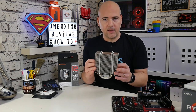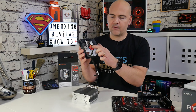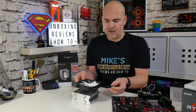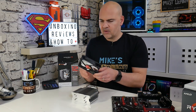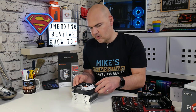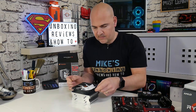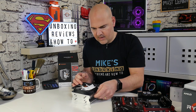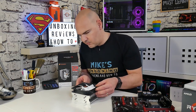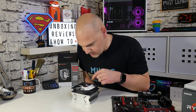So with that in mind, we're now going to mount the CPU fan. Put the cooler down onto a flat surface and, with your cooling fan, make sure the thermal tape badge is facing towards the cooler and the wire is coming out at the bottom — you don't want it coming out on the sides as it will get in the way of the spring. With the cooler roughly lined up, grab your two springs. The springs are the same so it doesn't matter which is left or right. Put the hooks through the fan's screw-mount holes and gently rest them in place. Look through the blades to check the fins of the cooler and ensure there's an equal gap top and bottom.